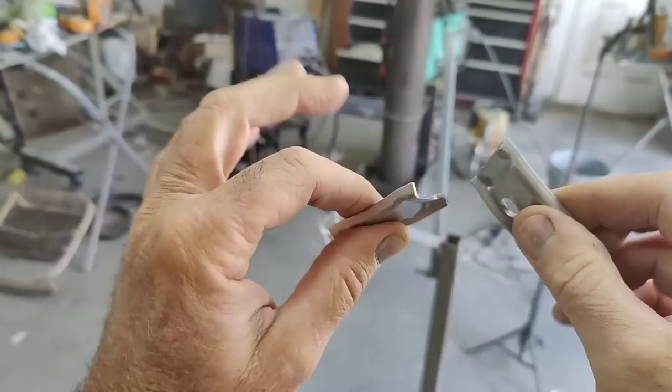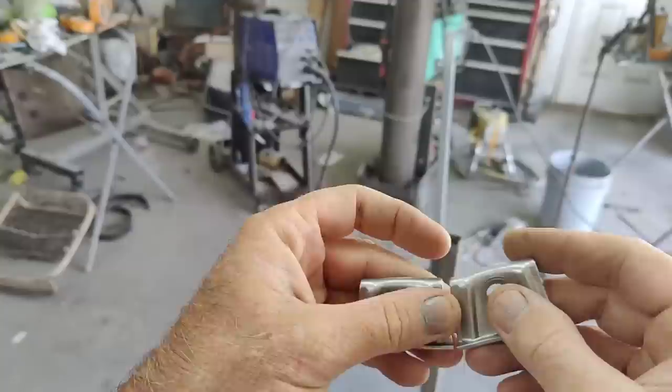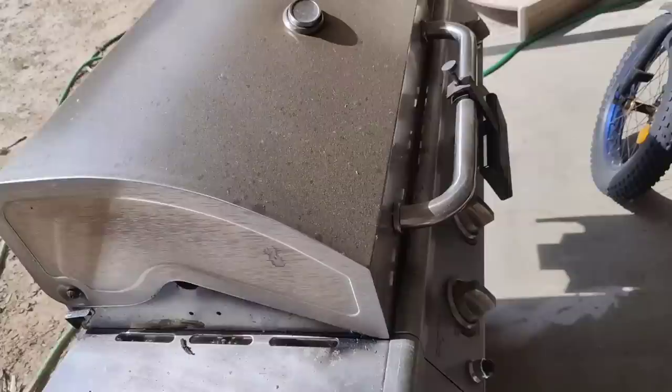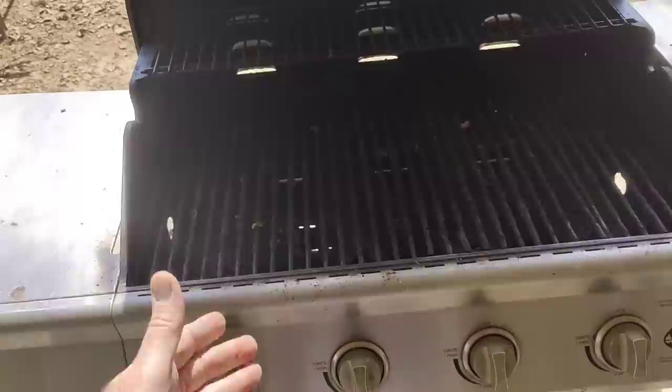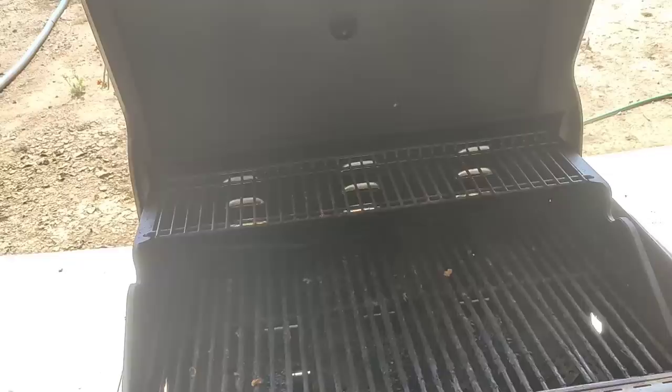So you don't need an oven to do powder coating. Some things are going to come out better in an oven, but there are literally like 100 different ways to make an oven. A lot of people think you have to buy a $5,000 oven. Some guys are using old household ovens, but there are even easier ways. For instance, you could take an old barbecue, one you found at a swap meet, and if you have a plasma cutter, cut out pieces of steel and make a cabinet that you put above it.